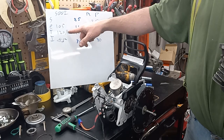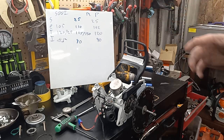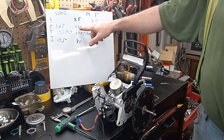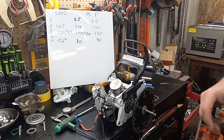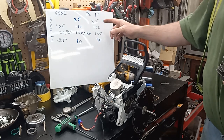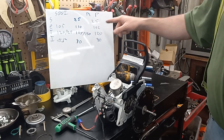Stock numbers were 105 exhaust, 120–125 on the transfers, and 85 on the intake — with a base gasket. After machine work I was at 25 squish, 110 on the exhaust, 125–130 on the transfers, and 90 on the intake. So just without touching a grinder to it — just machine work — I was able to move all those ports that much.